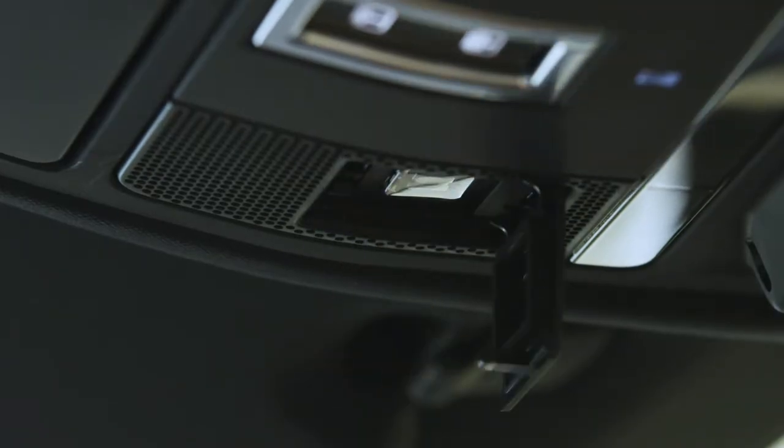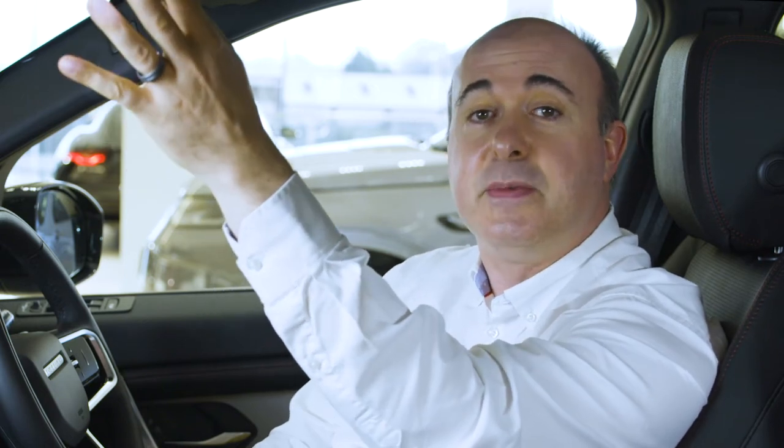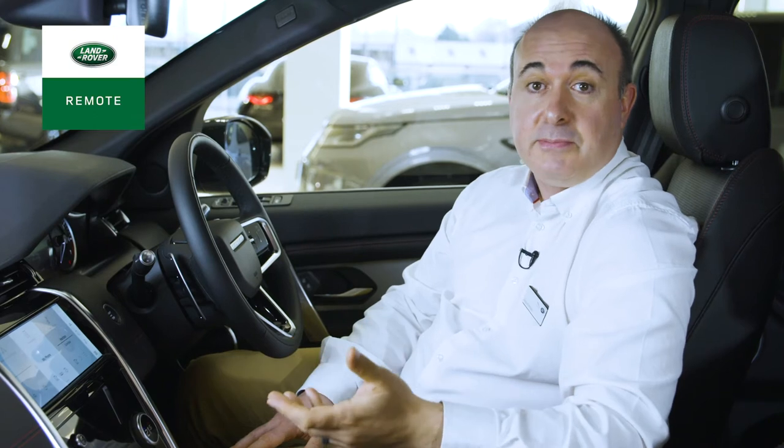To make the most of the advanced connectivity features offered by Discovery Sport, you'll need an InControl account. If you don't already have one, you can create one at landrover-incontrol.com/owner. To add the car to your account, it'll need to be parked close by in an area with good signal. When prompted, add the Discovery Sport to your account by pressing and holding the roadside assistance button located in the overhead console until the light flashes at a slower rate — this should take around 10 seconds. You have 60 minutes to complete this step, then return to the website and follow instructions to complete registration.